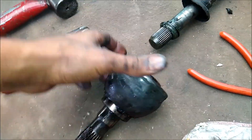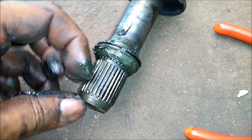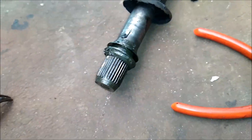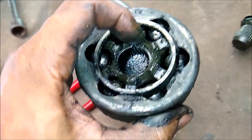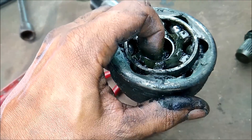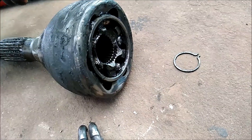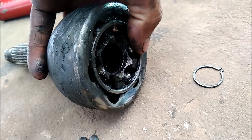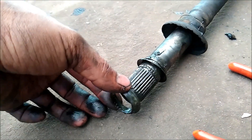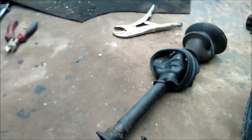There — done. Can you see? That ring sits here — it's held here. Can you see how it works? It was assembled like this: the plastic bushing, the washer, and don't forget the ring. The ring is what locks the homokinetic joint. And here the grease had dried up a long time ago — that's why it wore out. So this piece was in this condition, and this other small lock here was also in that state. Now disassemble everything here and wash it.